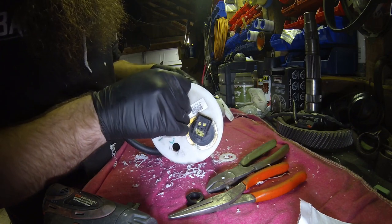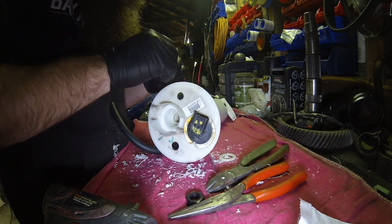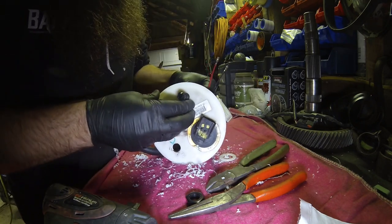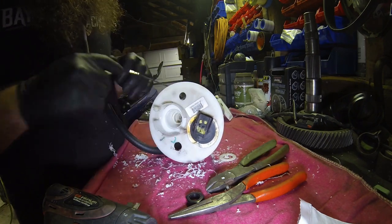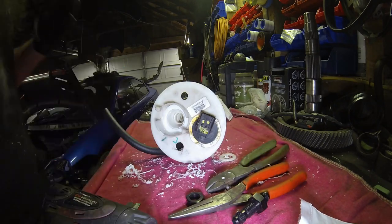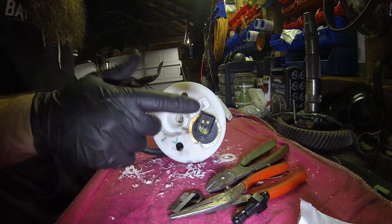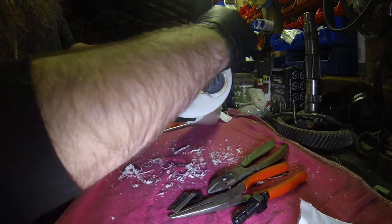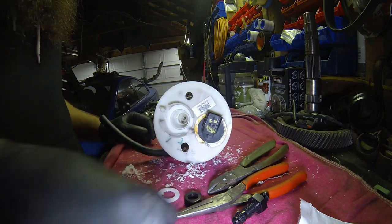I guess I could have gone one size smaller on the other one, but I might still have to do a chamfer on this. Well, there is a little bit of a chamfer on the fitting. Let's see. Yeah, it rocks a little bit, but it'll tighten up. I could have gone a little tighter on the small bottom feed line, I guess, but we'll be okay. It's only maybe a 16th of an inch with all I did there, so that washer is still bigger than the hole. That one right here, see, it's still bigger than the outer perimeter of that one. So we're good to go, no worries.